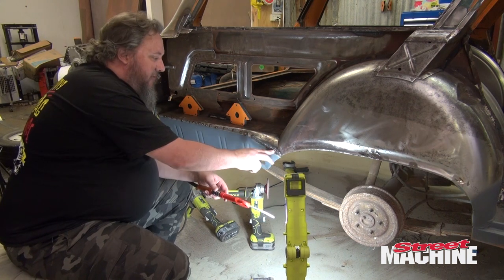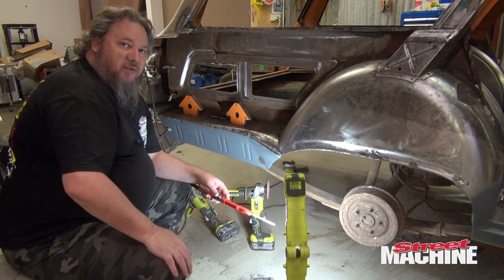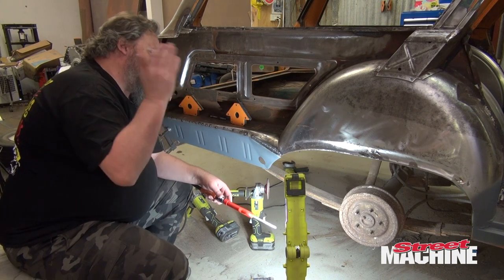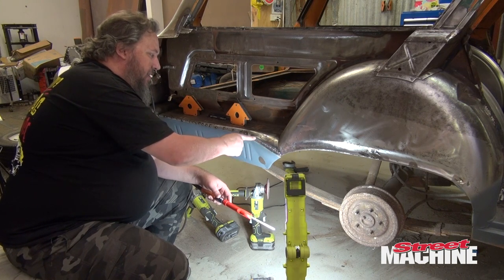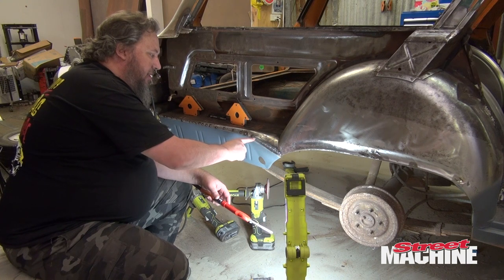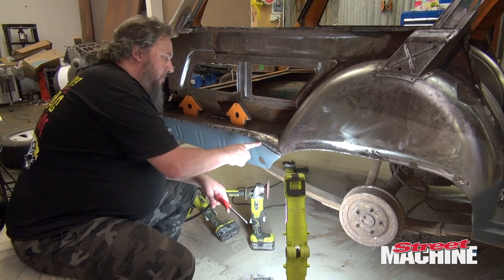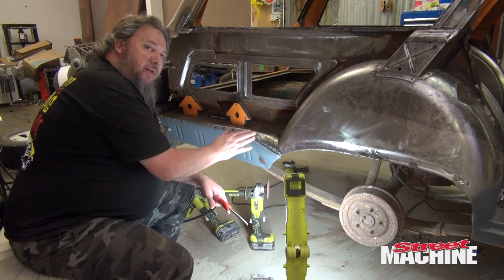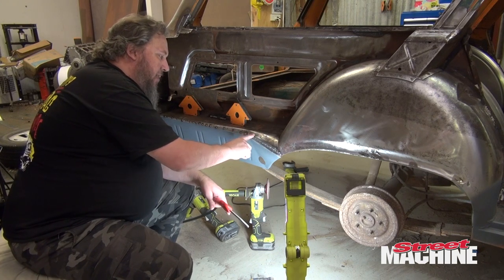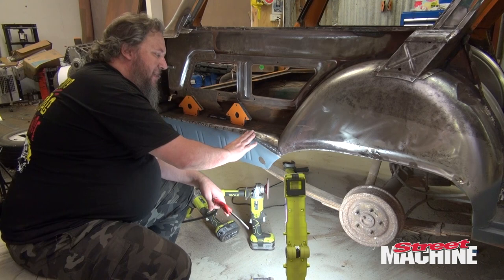As I said, I started off over here with the wrong power settings — I forgot I'd bumped the welder knobs from when I last welded sheet metal, and had too much power and blew through. So I went back and adjusted it — it's a bit of a booger weld up here. But as I got into the swing of things, you can see these nice interwoven tacks. I find it's the best way to do edge-on-edge, like a butt weld of sheet metal. I just went from the clean, fresh metal, overlapping each weld by about half — I get good penetration that way and a fairly neat-looking weld that is easy to grind back later.